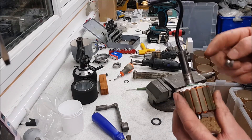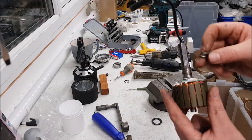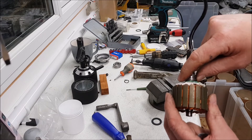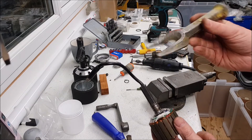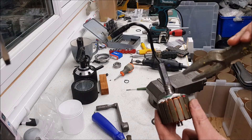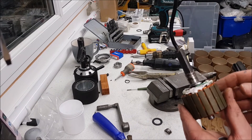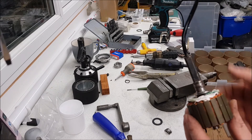I've literally had to cut it off in the end. Now I'm going to sand the rust off and put the new bearing on, hopefully without having damaged the board - I've been banging it out with different wedges, screwdrivers and stuff to try and get it out. There's not a big enough gap to use a puller tool without damaging the circuit board. It's been a bit of a nightmare. Just bear this in mind when you're changing this over - you might need to do a little engineering to remove it because it was literally welded on by rust on the shaft.